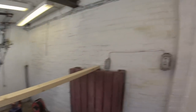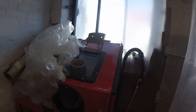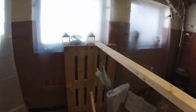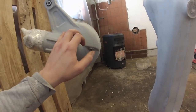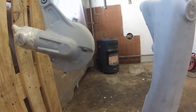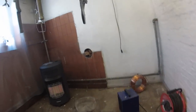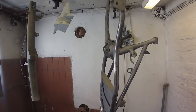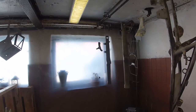What I did was bought a sandblasting cabinet and I have blasted the surface on all the parts. Some of the parts which are powder coated are just glass blasted, so the surface is really rough so the paint is going to stick to it. Other parts are blasted with aluminium oxide, so that's a bit more rough.